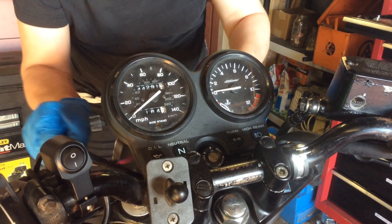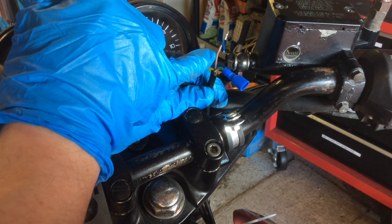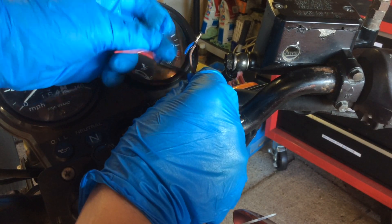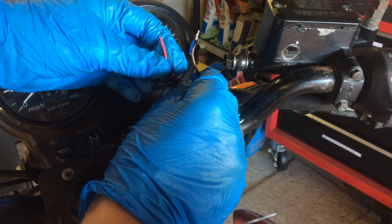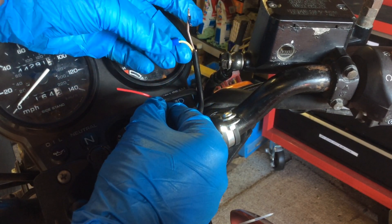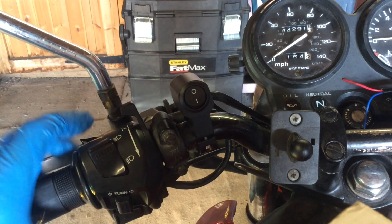The cable length is the same so that's all good. The brown wire comes from the battery — that's the live feed. It was connected to the blue-black positive side of the old switch; it will now just get connected to the new switch. I'll take the solder off there and solder this one in. Then this will be the wire running out of the switch — I'll just need to put one of these little blue female spade connectors on, and then that will go to the positive side of the voltmeter. Then through the green-yellow to the negative side and back to the battery. With the flip of this switch it should give us an accurate voltage reading, because we've got no little resistors lurking inside this time.